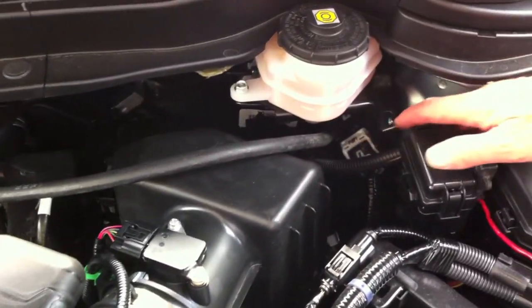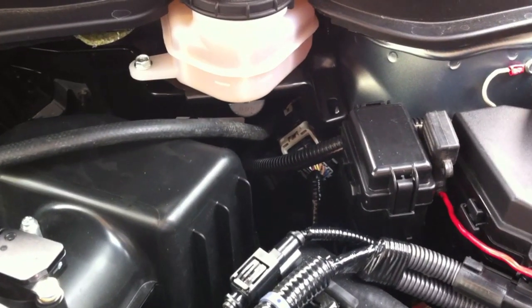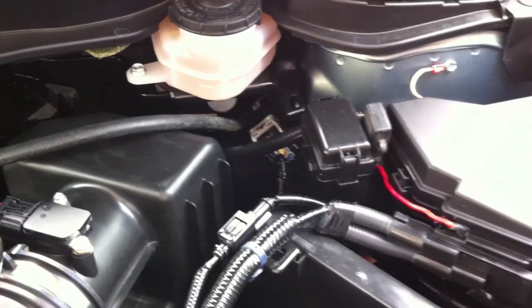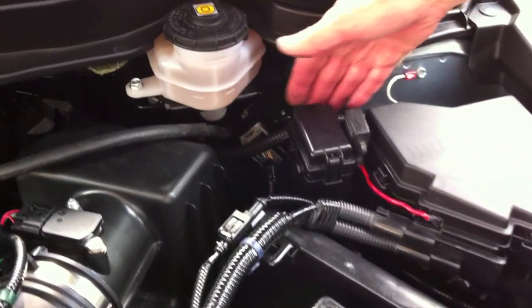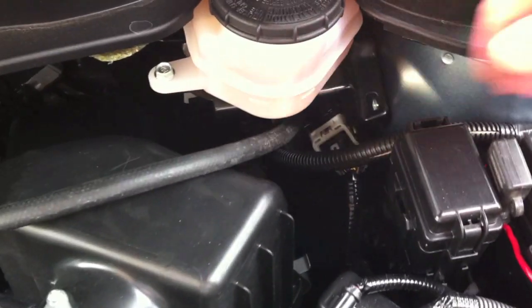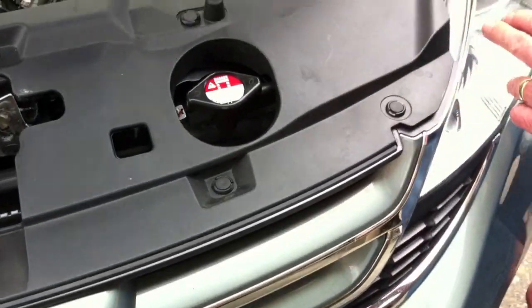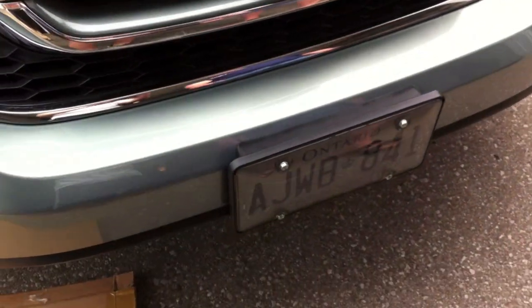When the wiring comes through that big grommet, it's going to come into the engine compartment. Even on this car, it's not often easy to find. However, if you use the coat hanger and push it through from the outside or inside of the passenger compartment, you'll then be able to pull the wiring through. Once you get it into the engine compartment, we recommend looming it — putting it inside a plastic loom — then running it around the fuse box and down into the front of the rad area. It runs down the front of the rad area and is now mounted on to the base plate.